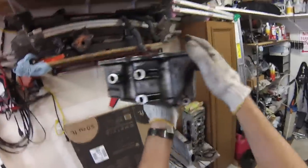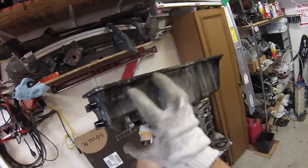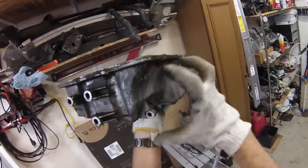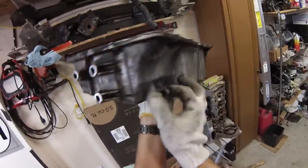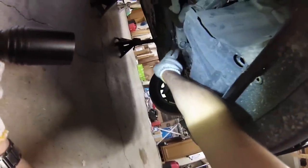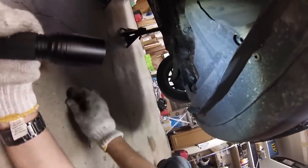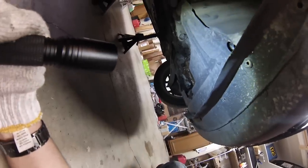This is what the oil pan looks like. On the front, the air conditioning compressor is actually attached to the bottom of the oil pan, so we have to remove the compressor and get it out of the way to get the oil pan off the car. One way is to put a ratcheting strap onto the rear engine mount and pull the engine back, but that's not going to give us enough clearance to also replace this O-ring. So we're going to put the car into front-end service mode. Let's start taking things apart.